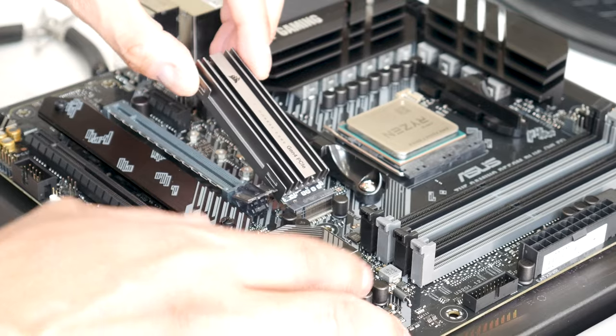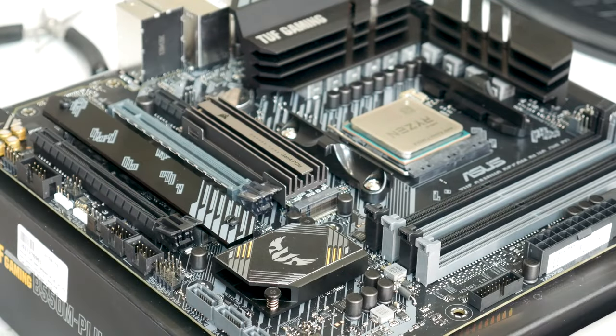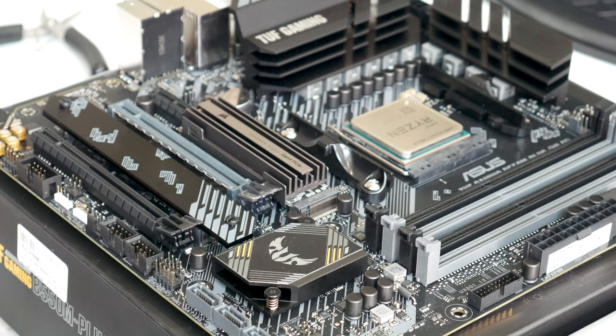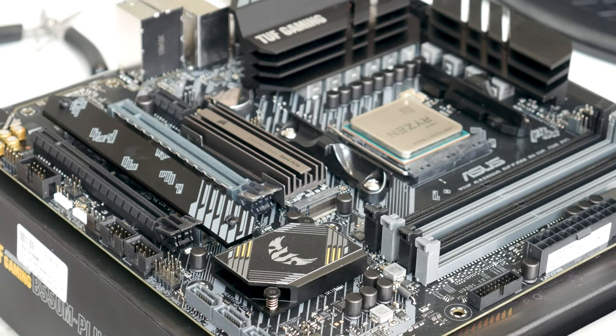This is going into a build I'm doing for a friend. Worth noting: it's got little clips on the sides and the SSD shroud looks like it's removable. If you pull back on those clips, you can pull it out and remove the SSD from the cooling shroud altogether. That's handy if you want to put on your own cooler or place it in an area behind a shrouded graphics card.